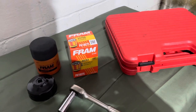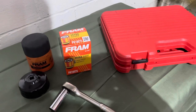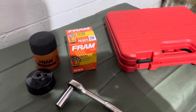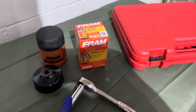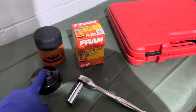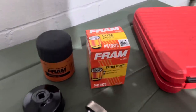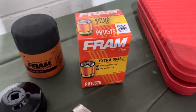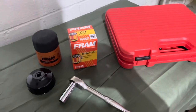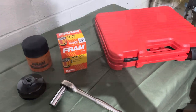Just to explain what kind of tools you're going to need in order to do your oil change on this 2009 Ford Taurus — one of my favorite cars, they are the most reliable, strongest American vehicles. You're going to need a 15mm socket with a wrench. To open the oil filter, just make sure you have the right size or a pair of pliers, whichever tool you have handy. This is the part number on the oil filter right here — I got the Fram instead of the Motorcraft. Let's get under the vehicle so we can drain the oil and remove the oil filter.